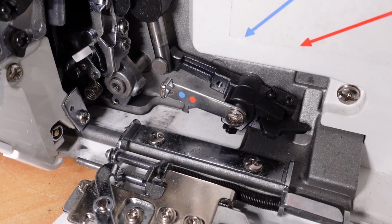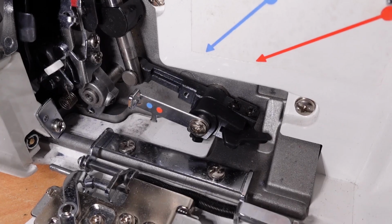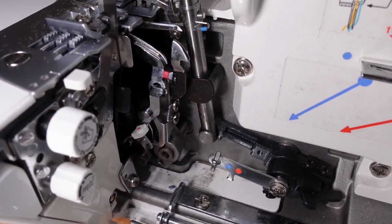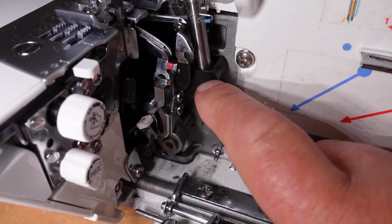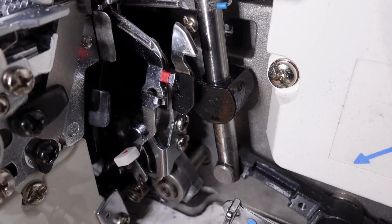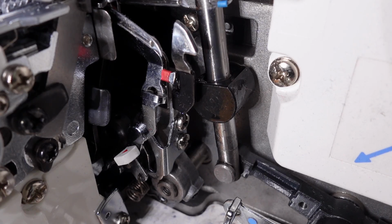moving. Right, so the drive shaft for the upper looper is not seized, but the fact that that's moving, but that shaft in that bearing is not, I would say fairly sure that this is where the seizure is here. Okay, so still not unbinding there. So let's get a little bit of heat on. I don't want to put too much on there.